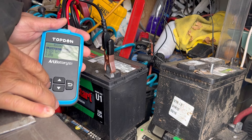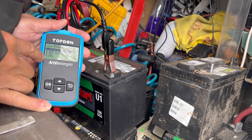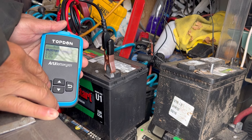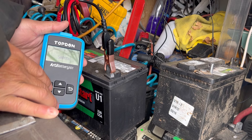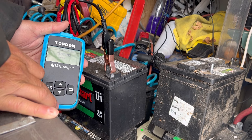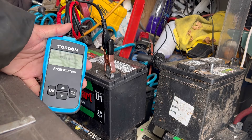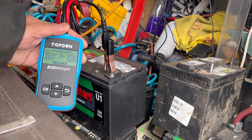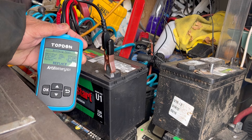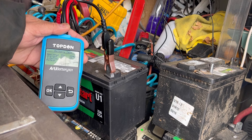So using a good battery, I press OK and it goes into battery test mode. I select regular flooded — it also gives you choices for AGM, AGM spiral, gel, and EFB. I select 500 CCA and hit test. It's not really a 500 CCA battery, but it comes back: health 35%, charge 100%. It says August 2021 on it — these Walmart batteries are not like they used to be.